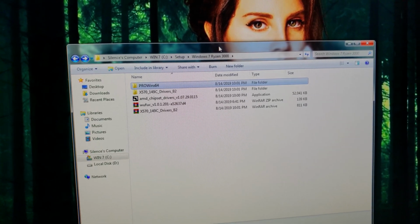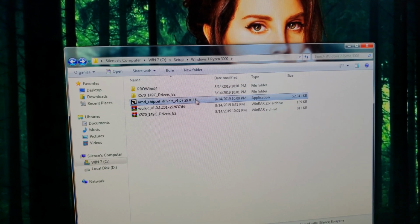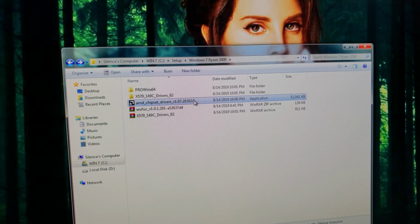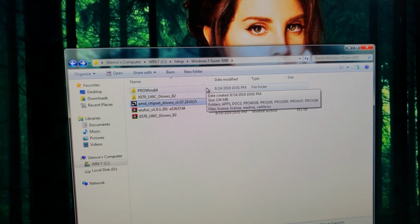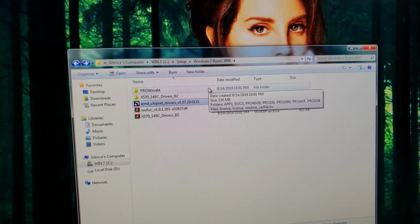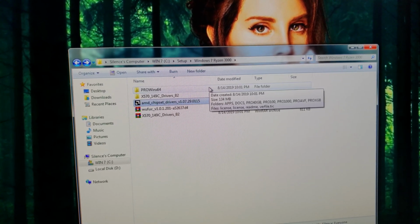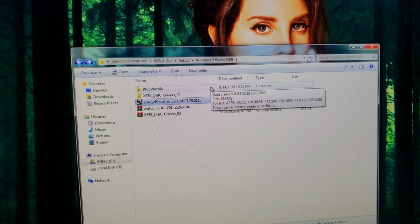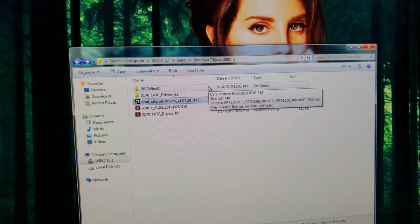A couple of other things you should probably get your hands on, just off the back, obviously: chipset drivers from AMD's website. Now I know you're going to scratch your head and say, well, Ed, I went to AMD's website and there are no X570 chipset drivers for Windows 7, and you are correct. However, scroll back to X470 chipset and you'll see Windows 7 again, and if you actually download both files from AMD's website, the one for X470 and the one for X570, they're actually the same file. And basically the chipset drivers are actually for both chipsets.